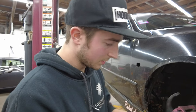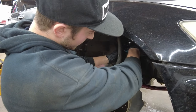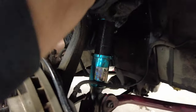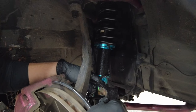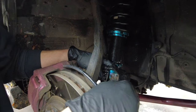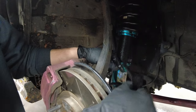Let's get the biggest spanner wrench, because I feel like this is the right size. And we're gonna just start unscrewing this puppy. Also, always lube them. I don't know if we videoed that. Always lube your damn coilovers. Another good thing is this collar. Kind of leave it where it was if you can, because you're not gonna have to stop and check 300 million times. You're gonna have to stop and check twice.